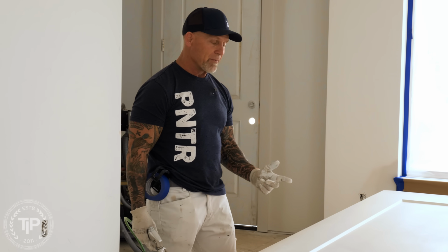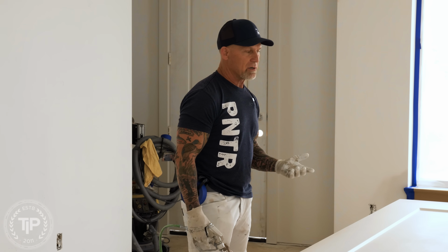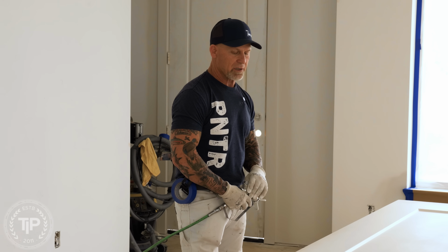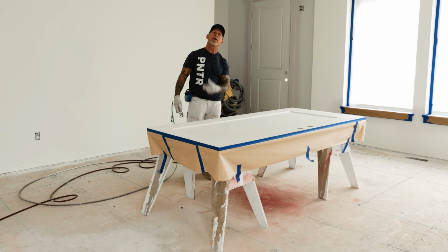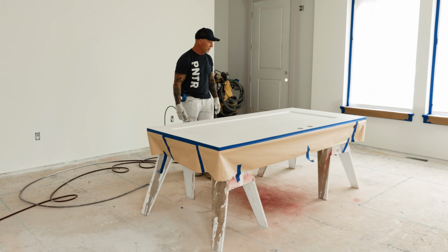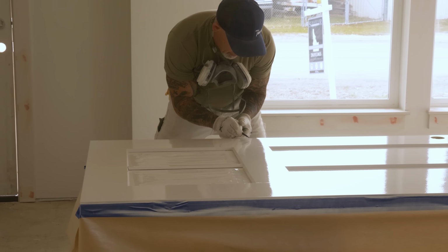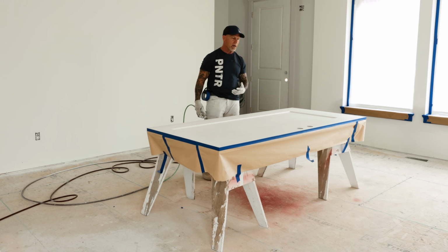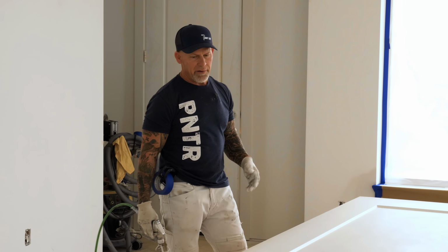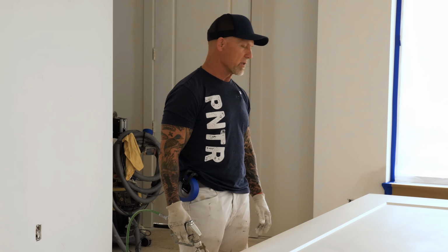If it flips it up on the door, you're gonna have to immediately wipe that door off, get that paint off, let it dry, and reshoot it. I say this because it's happened to me multiple times, paper flipping up, whether it be outside, because the wind flipped it up, or whether the pressure from the gun flipped it up. Bugs have landed on doors like this multiple times. Beetles walked across it. The cotton from cottonwood trees has landed on it. So we're inside of a protected area, so I'm less likely to have any of those elements once I spray this door.